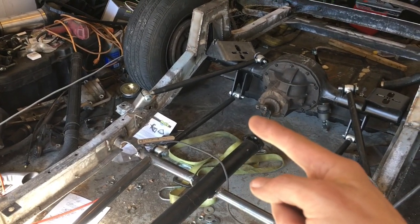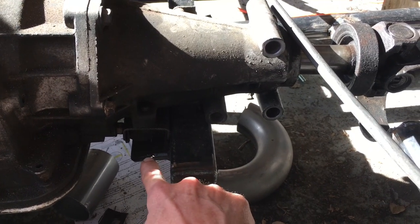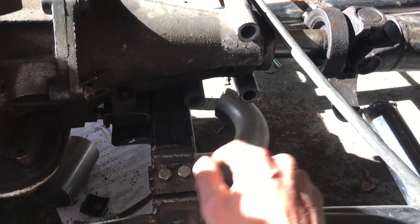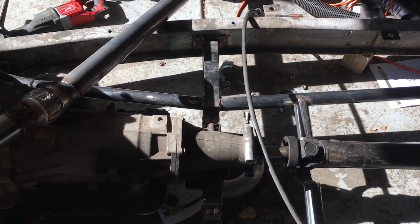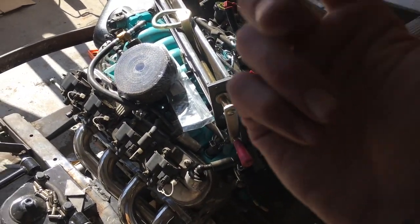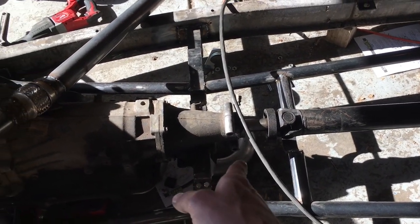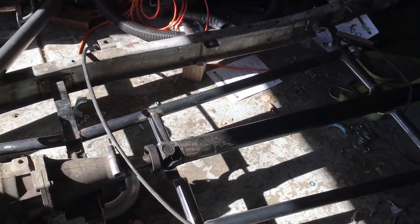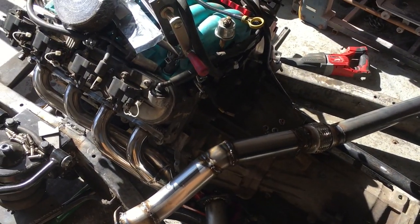Still have five inches there, but that's the three inches I cut off the driveshaft to put the 10-bolt into the '56. So two inches back plus the other three — I'm still going to have to have the driveshaft lengthened. That also means I have to re-engineer this crossmember to sit back here, right dead center, and hopefully the exhaust will just slide back those two inches. Either way, fun times — I now need to pull the motor and trans out, get those motor mounts swapped to the proper spots, set everything back in, re-engineer this, put the exhaust back in, hope everything lines up and adjust if it doesn't. This is why custom cars cost a lot of money, especially when you're a dumbass like me.